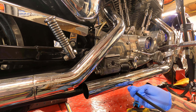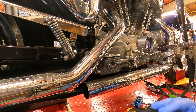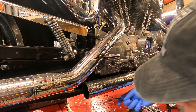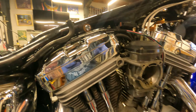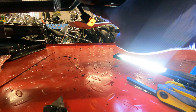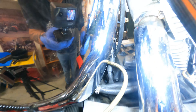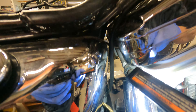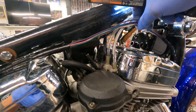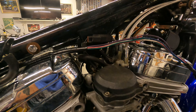What we're going to have to do now is feed these wires up through — you can cut these wires. Let me look at where I want to route these. So it's routing right up here to the top, along that line right there. I'll wire-tie this all the way up. Then we get to the coil and the VOES, and we'll be all set. I changed the routing to run it right along here with the wiring harness, and I can still reach the coil and the VOES.